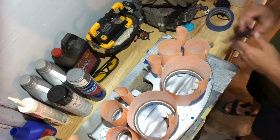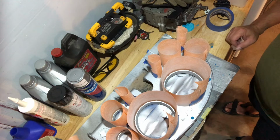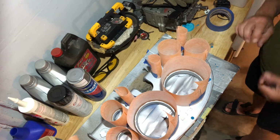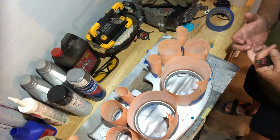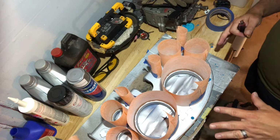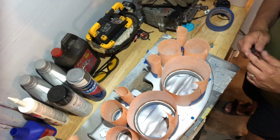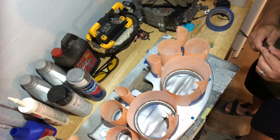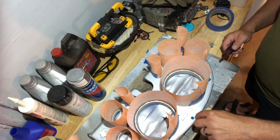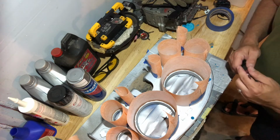And if you'll notice, in places like here, I've got these blue, probably from the video it looks to be tabs or circles, but what they really are, this is where the mounting screws go, and I couldn't find a way to plug those holes because the original one has it chromed or painted, and they're not black. So I'm being a bit persnickety here. I don't really have the NCRS rules on restoring the gauge, but I believe the gauge I took out was a 63 gauge that had not ever been restored. And so I remember some of the design language that I saw there, in which case these holes were silver. And then there is a small thin accent ring around them that was silver as well. I'm trying to preserve that.